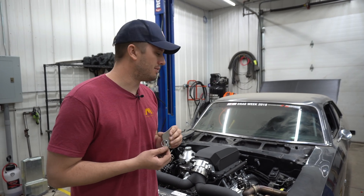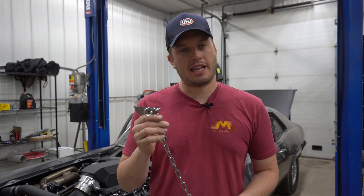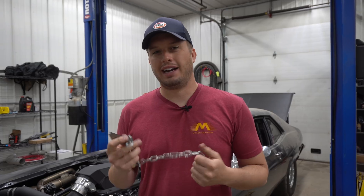A lot of IRS cars don't do wheelies versus a leaf spring or four-link ladder bar or whatever. Basically, if we can stop that spring from extending further, it's going to slow the inertia down in the front and slow the momentum of the front end going up. Going up and doing a wheelie is only good for the picture being shared online the next week, but it definitely doesn't make you go faster. And if you get in one of these high horsepower cars and it starts to come up, it's not a whole lot of fun because they usually don't want to come back down. That can be really expensive on parts — control arm slamming, oil pans, transmission pans, and everything else in between.